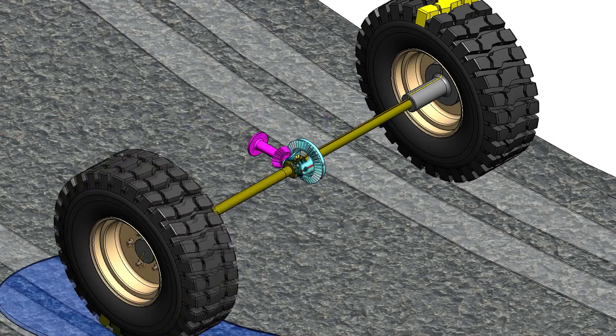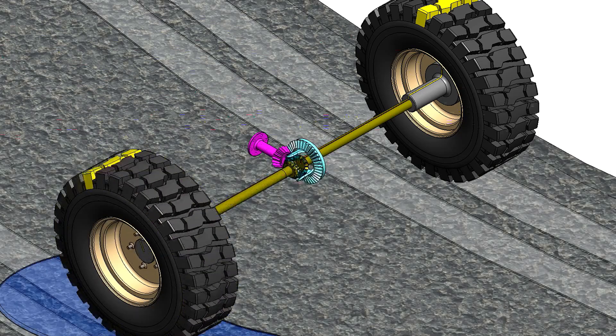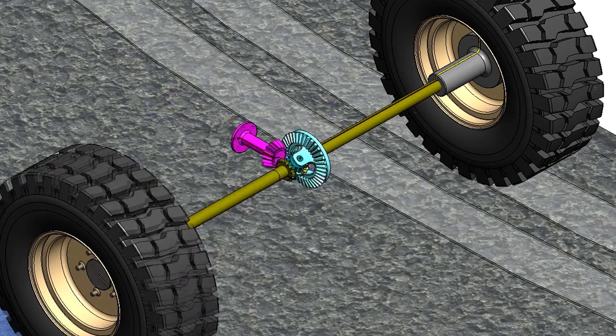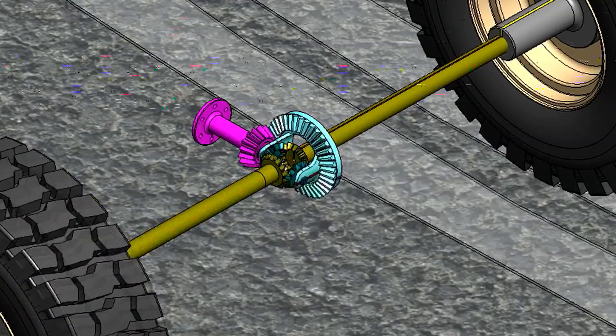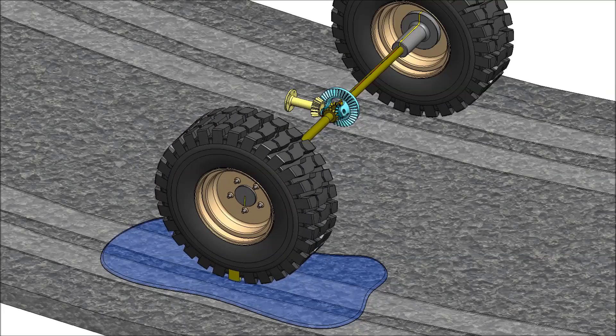The second problem is similar: what happens when one tire makes contact with a slippery surface? The torque to either wheel can only be as much as the wheel that slips. For instance, if the tire on the snow provides a tangent force of 100 pounds, then the opposite tire on pavement will experience the same 100 pounds force. The tire on pavement may not be spinning, but it still receives the same torque. Both wheels communicate through the spider gears in the differential. More driving force is available on the pavement side, but there is no mechanism to apply increased torque to that wheel. An open differential may have the worst performance off-road, but it is the most fuel efficient — there is no energy loss from turning a corner.